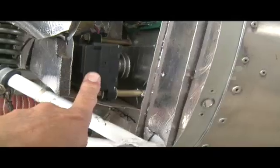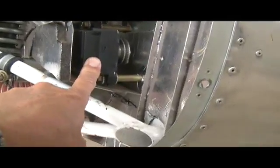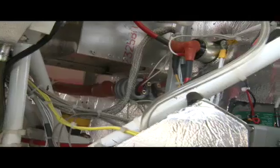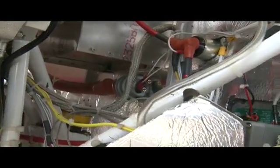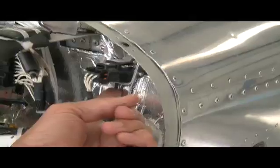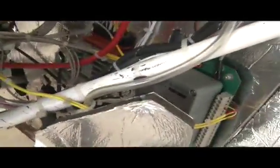This is the position that we put the turbo servo in — we put it in this position over here, you can see it's just below the RDAC. Just above that we fit the relay for the starter. Underneath the battery box over there you can see the fuel pressure sender unit. This is the pressure sender — it must face down like that. The other thing I need to point out is that the rectifier regulator, which you see over there, the plug must face downwards.